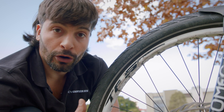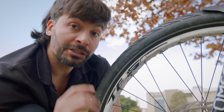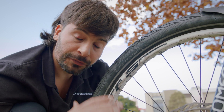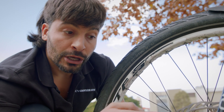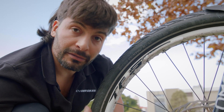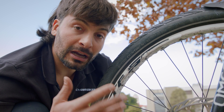If you are a heavy rider, your bike is heavy, has a big hub motor on the back wheel, or is a cargo bike where you're always carrying heavy loads, pay attention to the tire pressure. If the tire pressure is too low, you're going to cause damage to the rim, to the spokes, to the bearings — and it can be catastrophic if you hit a pothole at high speed.